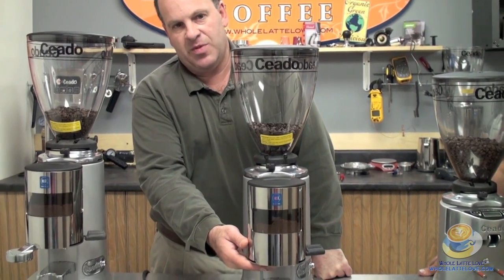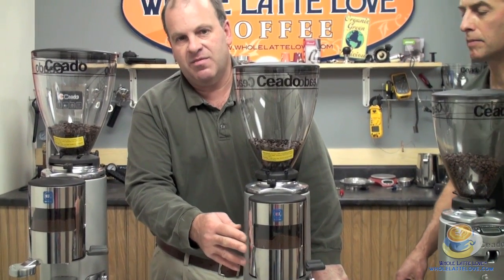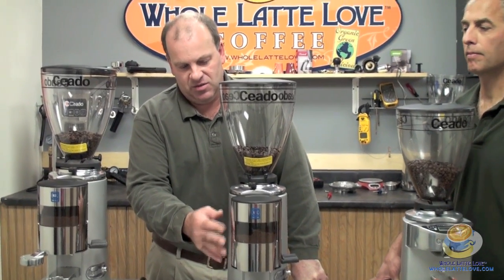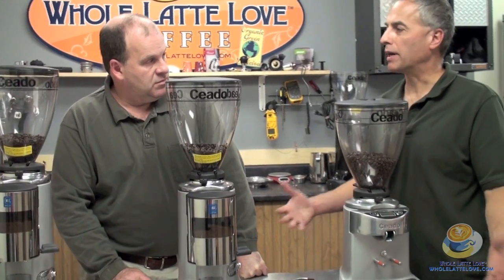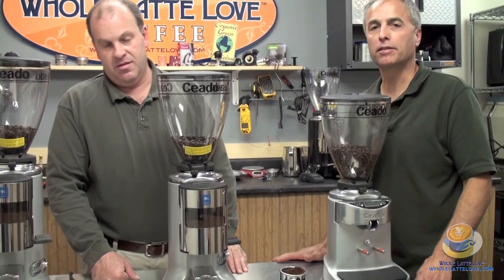But basically what rectified means is that the dosing unit and the shaft that turns it are perfectly perpendicular. The other nice thing about that is that a lot of people talk about how the grinder doses. It makes a very clean sweep. It's not going to leave a lot of grinds in the bottom. So it's actually a great, unique feature. By being rectified, it doesn't wear out early. It'll last longer. It just means that the bolt is perfectly perpendicular to the rest of the unit.